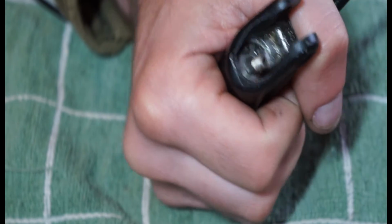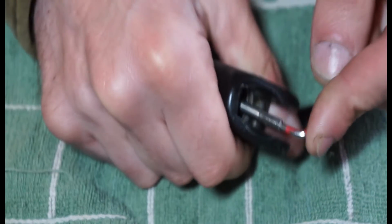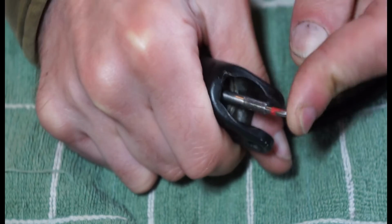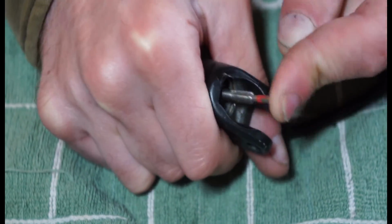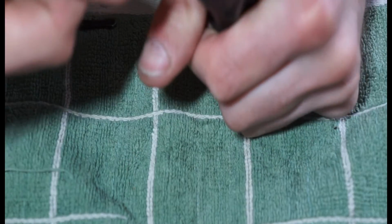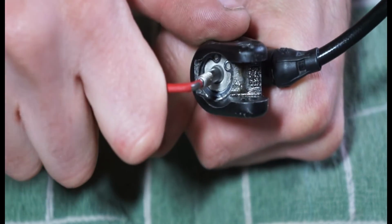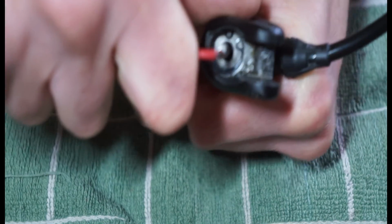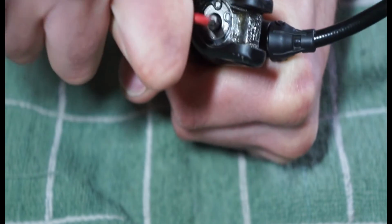And the other thing is as well, you could just push on that rod a couple of times. So put the Allen key in there and make sure that the circlip stays in place and holds what it needs to hold in place. The other thing you can push on there and just have a look at the washer as well. If you push on that and the washer drops, it might be that the circlip's a little bit too high and the washer's not seated in the right place, but that washer's quite happy to stay where it is.